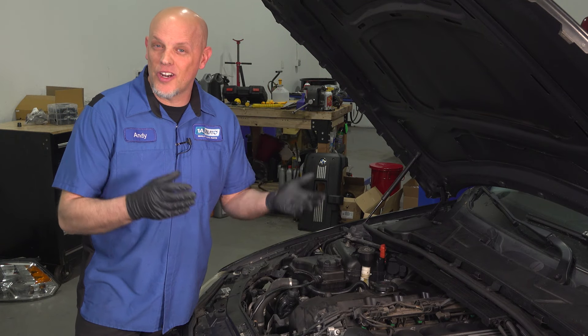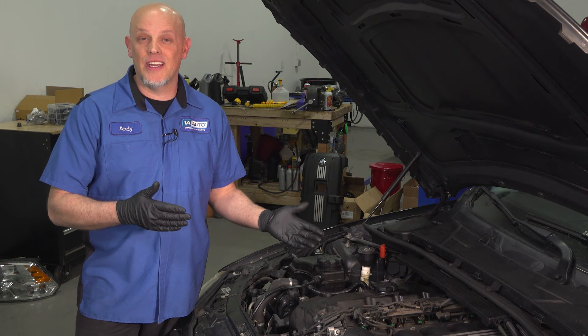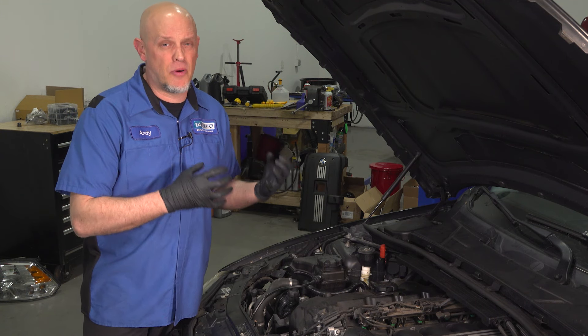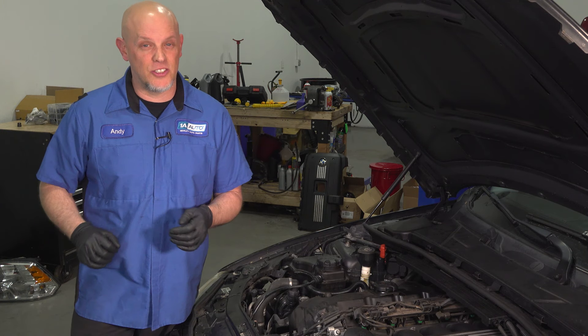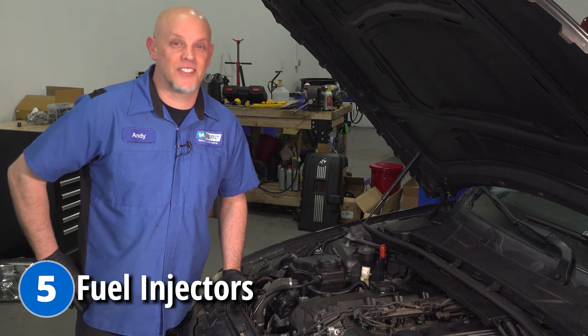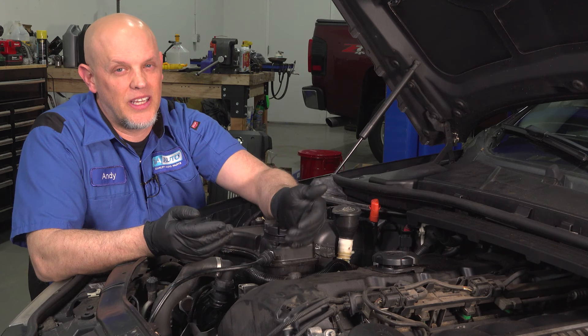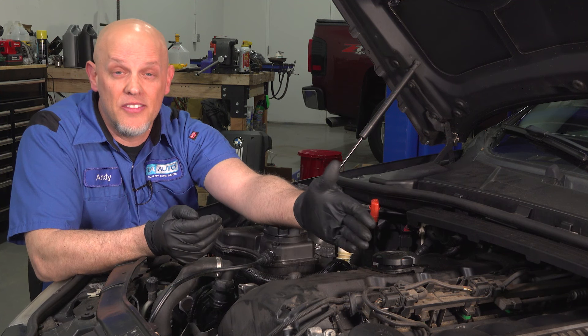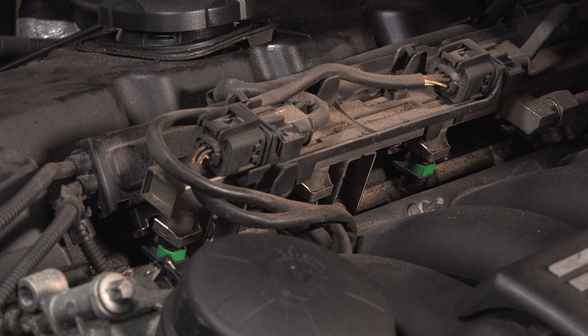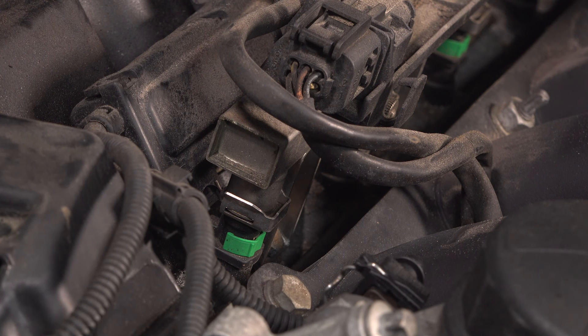When your vehicle is running rough and the check engine light is flashing, it means your vehicle has a misfire. It's never a good idea to drive it — you're going to cause other components to fail, and it's going to cost you more in the long run. That leads us to our last problem: the fuel injectors. On most vehicles when you have a misfire, it's related to the coils or the spark plugs. That could also be the case here, but more often than not, there's a problem with the injectors. If you know which cylinder is misfiring, swap the injectors — if the misfire moves, you know that's a bad injector.